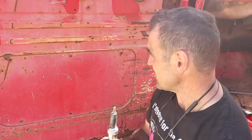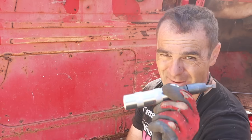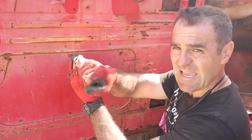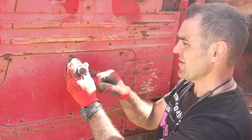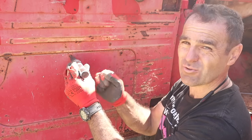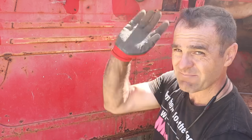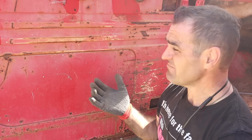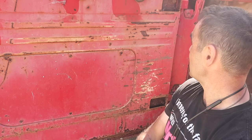When pulling apart one of these old cars, one of the tools you really need to have is an old-school impact driver. It takes a bunch of different screwdriver heads, but the benefit is that as you hit the tail of it, there's a cam in it that turns very slightly and breaks the screw loose. That's about the only way you're going to get some of these old screws off without demolishing the head and making a mess. It's a must-have for pulling this old thing apart — so far it hasn't been an absolute nightmare. A lot of cutting with old bolts, but not too bad.